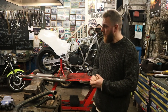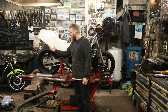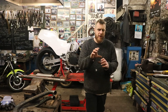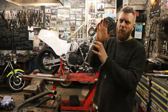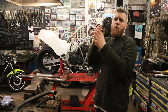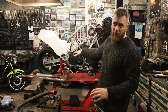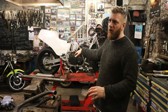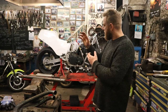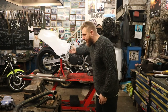It was. Basically, because I had the suspension jacked up in here, swing arm jacked up, and that put the bracket smack bang on where swing arm were, but I wanted the swing arm up so I could leave silencer in its perfect place, weld the bracket on while it's all there. That means I can drop back end down now, and I know that it's been checked. It's been built with a back wheel up in the air. So we know that's totally fine now. I've double checked it, welded the bracket on, which has fixed it there at the back end.